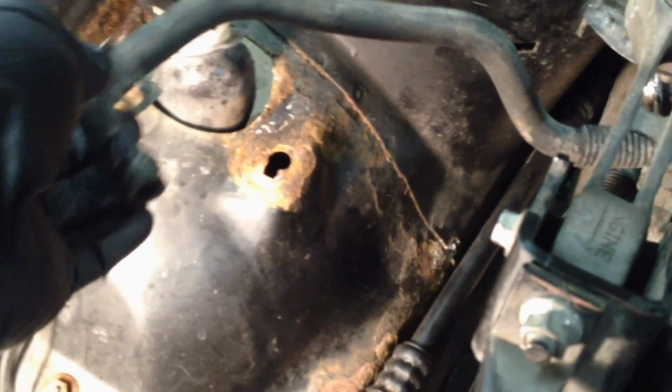Let's get this air bleed hose on here before we put the intake on. It goes up and over, retains here and here, into the little stud sticking out of the valve cover, goes underneath, and then it comes out in between all that. And it'll eventually go to our bottle. I have my bottle off of here for ease.